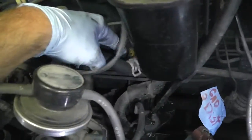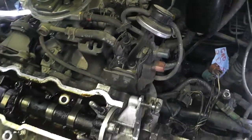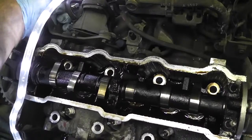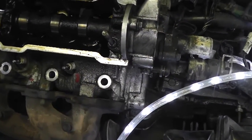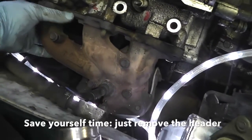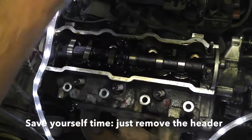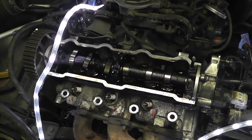Using a pipe for extra leverage worked okay for me — figure it out for yourself. Good news: I got the cylinder head bolts out. I disconnected this hose from the back here because it looked like the only thing still attaching all of this to the top. And if I give it a good tug, it's moving. So basically it's off the engine now — I just need to pry it away from the exhaust manifold and bring it up and out. I may need a partner or I'll just wrestle it for a bit.